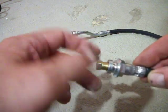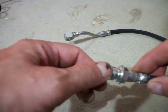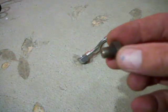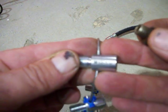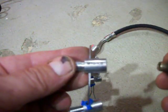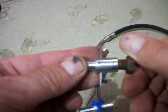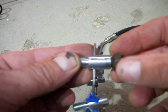For some reason or another I decided to try the metric ones first. When I pulled the old sloppy lines off — I have a sloppy one right here, it's all corroded and everything — I decided to check it on a metric gauge. This is an M10 1.0 metric, and watch this: this hydraulic fitting screws into it perfectly.